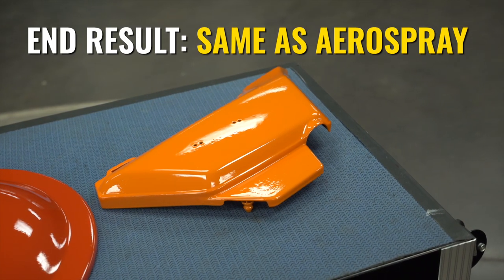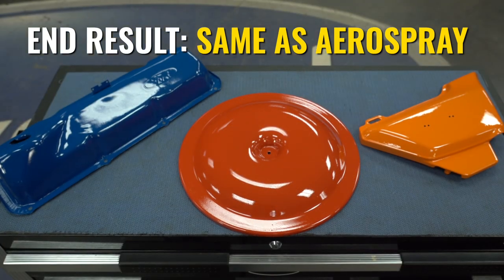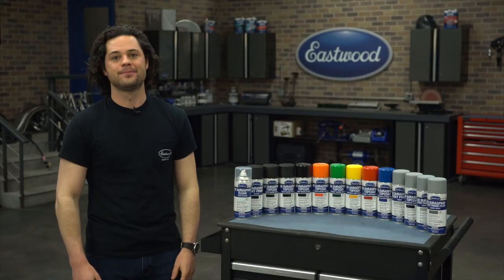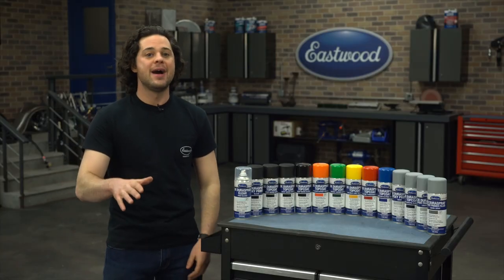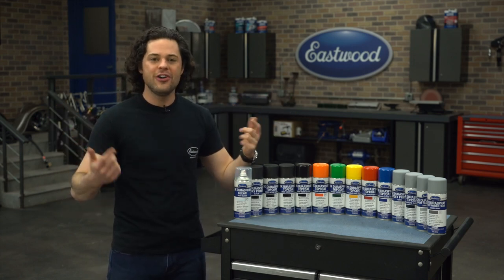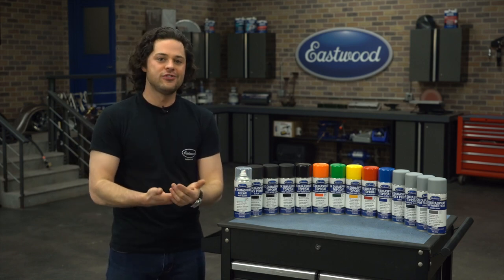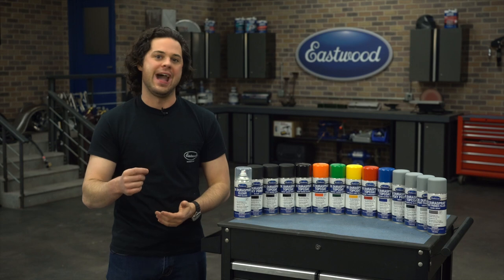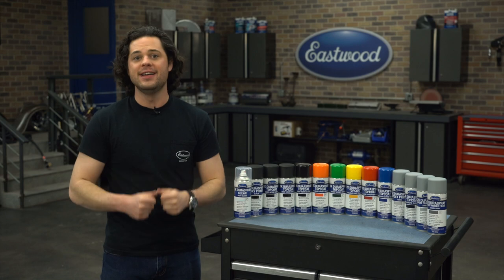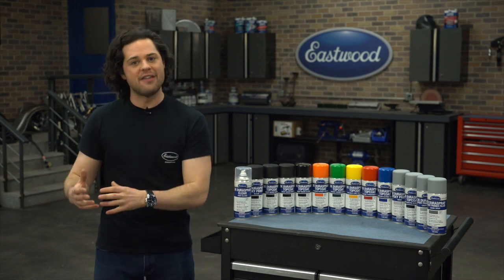But after full cure, you're golden — fully hardened and UV-resistant, just like a regular 2K paint, and ready to hold up to chemicals or solvents like gasoline. You can speed up drying times with some extra heat, infrared radiation, or even extra moisture on a humid day, since moisture is what activates the chemical reaction. As a good rule of thumb, always spray at room temperature — 68 degrees Fahrenheit — and keep humidity somewhere between 25 and 75 percent.